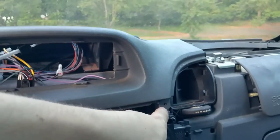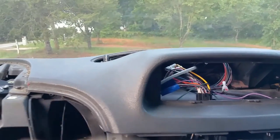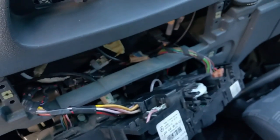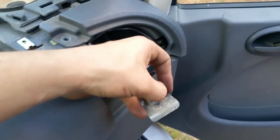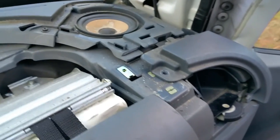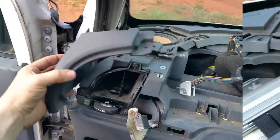There are a lot of wires to remove — this could be a headache. These two bolts were missing, but that piece needs to be removed because if you don't, you'll break the dash since those bolts are usually there. Sorry about moving the camera — I'm trying to help you guys by removing this and filming at the same time, which isn't the easiest job. For this one I'll actually have to press that little knob with a screwdriver, then remove this bolt and that bolt. This little piece that attaches over here also needs to come off because it crashes into it and you cannot remove the dash otherwise.